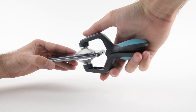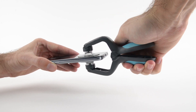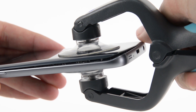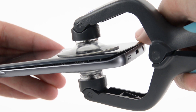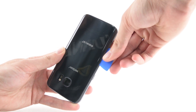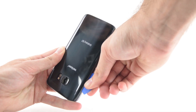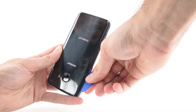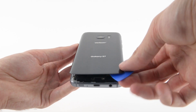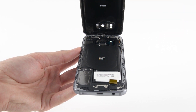We had to break out the claws — the iSlack and the iOpener — to get this open, and found a whole lot of glue and not much else. The opening procedure is similar to last year's S6, the only difference being a slight increase in stickiness and a change of color in the adhesive tape. This adhesive is now black, possibly for better color matching, possibly a new formula. With the rear case removed, all we find is a smooth surface for sticking, and fortunately for us, some screws.